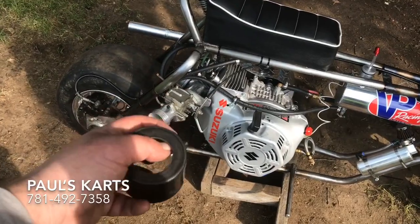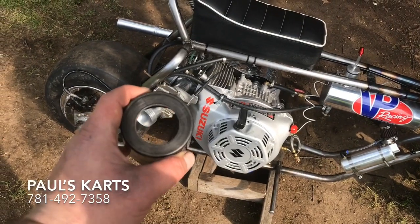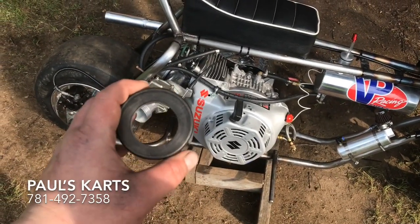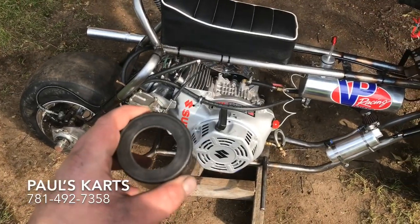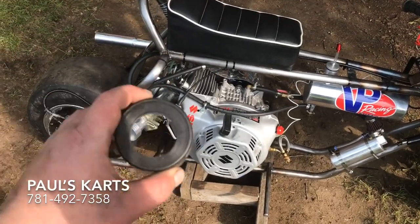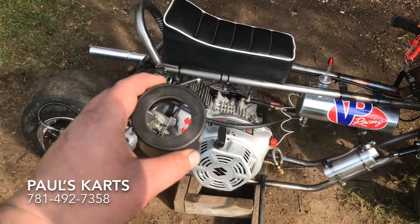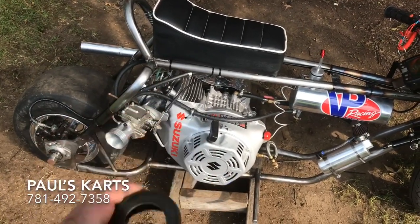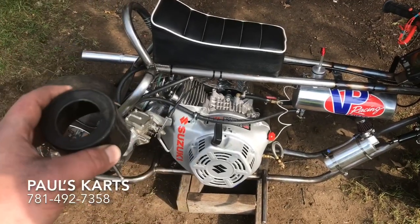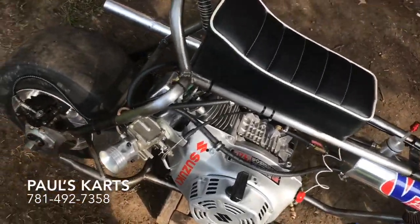That's why the Mikuni — if you have a Tillotson, you can try just taping off a small part of your carburetor. By taping off a small part of your carburetor, you are letting in less air, which will give you a better fuel-to-air ratio. So if on the top end you are running lean, you could take a little bit of tape, put it around the edge of your carburetor, and you will have a richer carburetor. You can just keep messing with sizes until you've got it dialed in perfectly. It will feel a lot better — I did it myself, it felt great — but I lost 10 miles per hour in less than an eighth mile. I'm doing less than an eighth because I'm not going that fast, but consistently 10 miles an hour. So what's the fix?